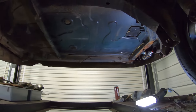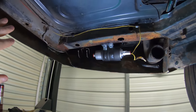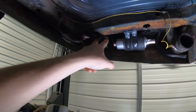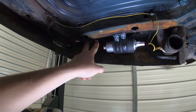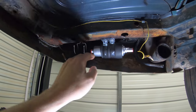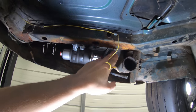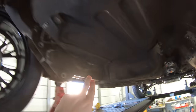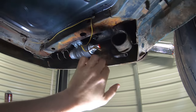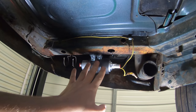Here is the underside of the car. Back here is where the tank would normally sit, and this is where I've gone ahead and put the 255 Walbro inline pump — it worked out pretty well. That little feed port on the back of the tank will come out right here. I'm going to put a stock-style pre-filter in it, like a little plastic paper filter type deal. I'll come out of there to the rubber line, then I got an adapter to adapt AN fittings from there. I'm going to run AN up along the inside of the car, kind of like it was originally. I can also take the wiring, go up into the car, and put the relay for the wiring up in the car.